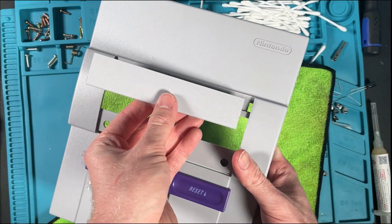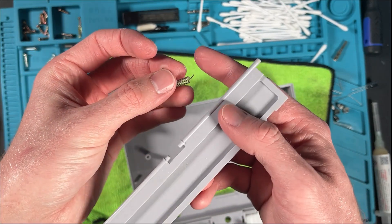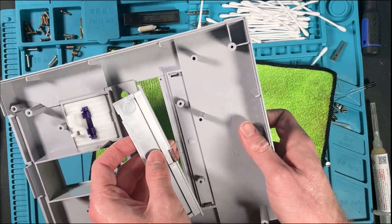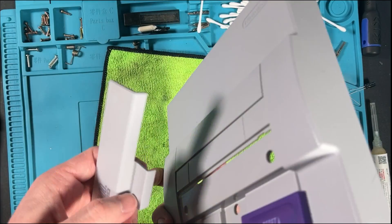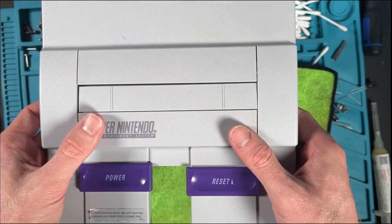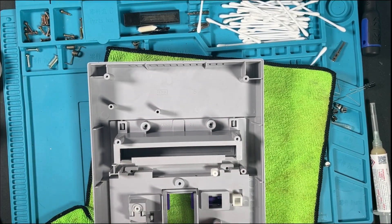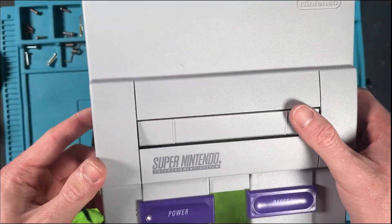We might as well put this little piece on - it's the back part, it just clips in. For the door, we want the spring facing the little part under the door so it's flush. That little hole is where we put the arm of the door - just like that, so it just sits there. The top SNES logo pops between the two sliding buttons. Final piece - push it through; this is what actually pushes the reset button down. Lay it down and install seven screws. That is our top case done - looks super nice!